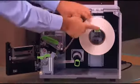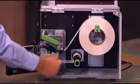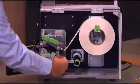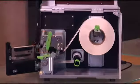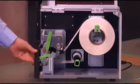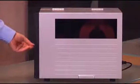Once you've done so, reposition the roll guide so it is touching the roll media. Position the label guide so it is touching the media itself. Close your printhead, close the bottom of the front cover, the side cover, and you are ready to print.